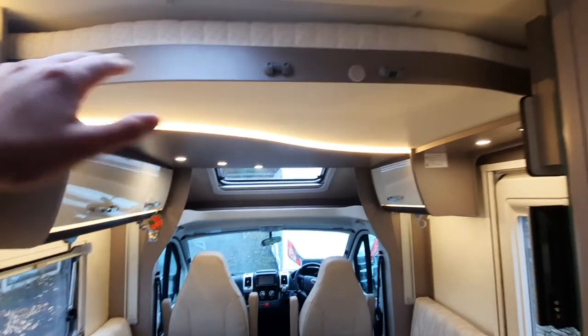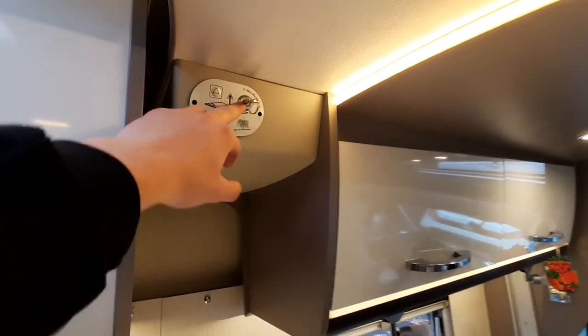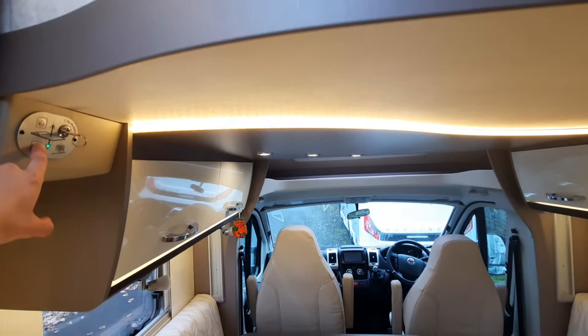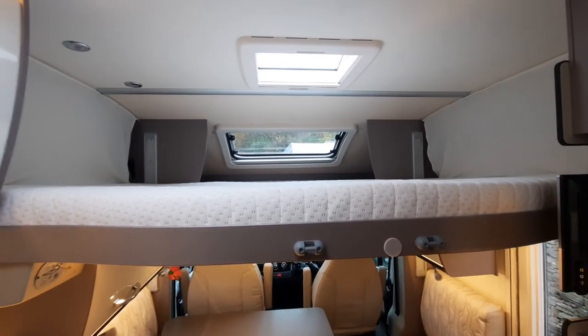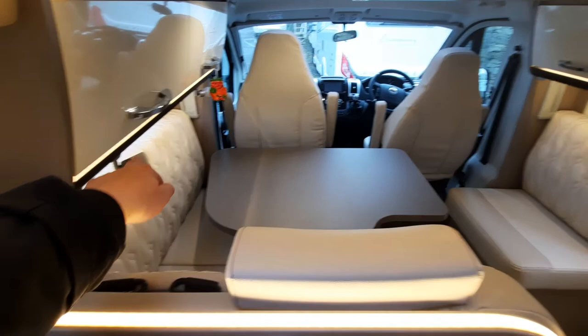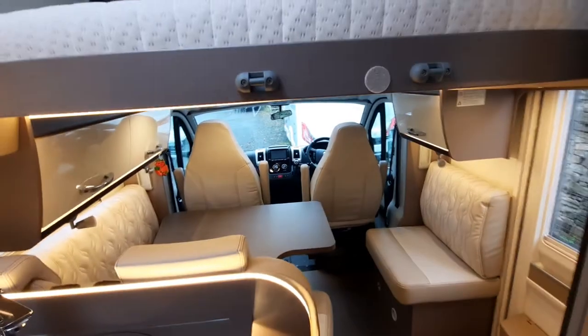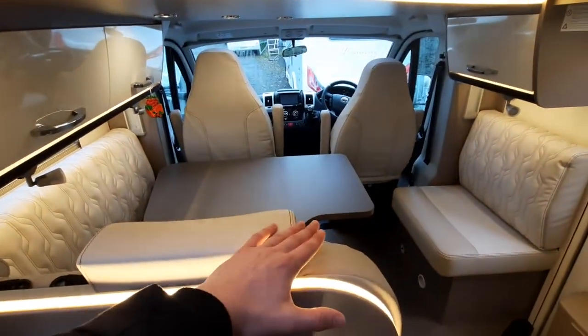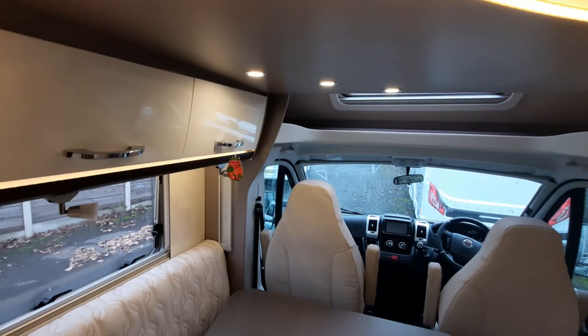Moving forward in the vehicle you have a drop-down bed. With electrics on, turn the key and simply hold the switch to drop the bed — as soon as you let go it stops. Use the ladders to get up. To get it to its lowest position, remove the back rests on the cushions, make sure the lights underneath are folded in, clear the area, and drop it to its lowest level. As a rule of thumb, all bedding can stay on the drop-down bed — just move your pillows to the front.